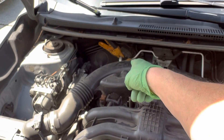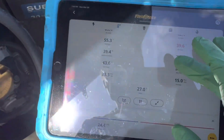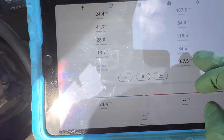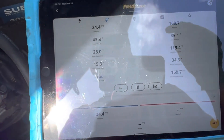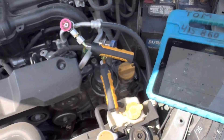We've got the temperature sensors — wireless Bluetooth here in the dash and wireless sensors. We've got 13 degrees superheat and 34 degrees subcooling. That's at idle — remember it fluctuates when it's off idle. I'll catch you guys later on the next one.